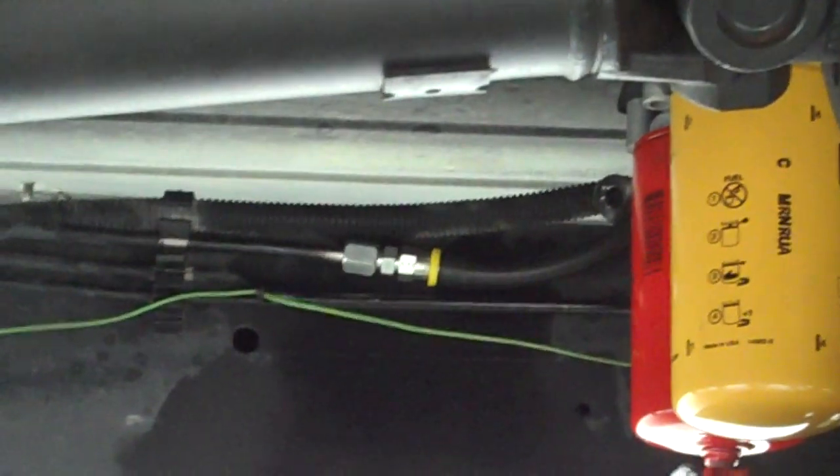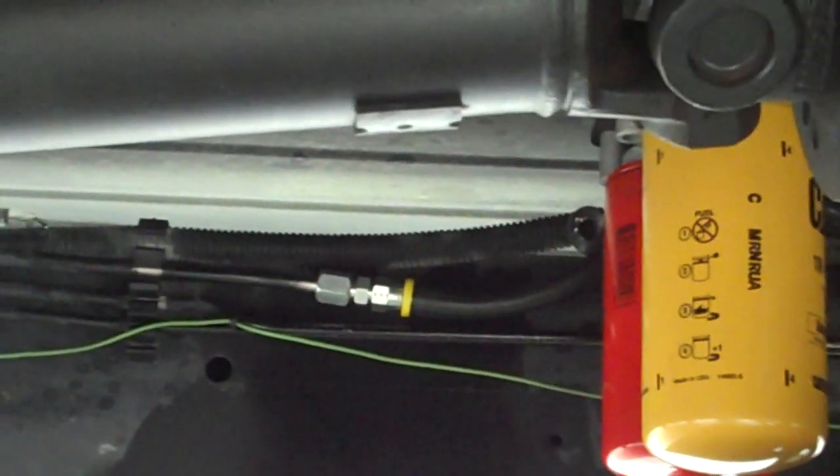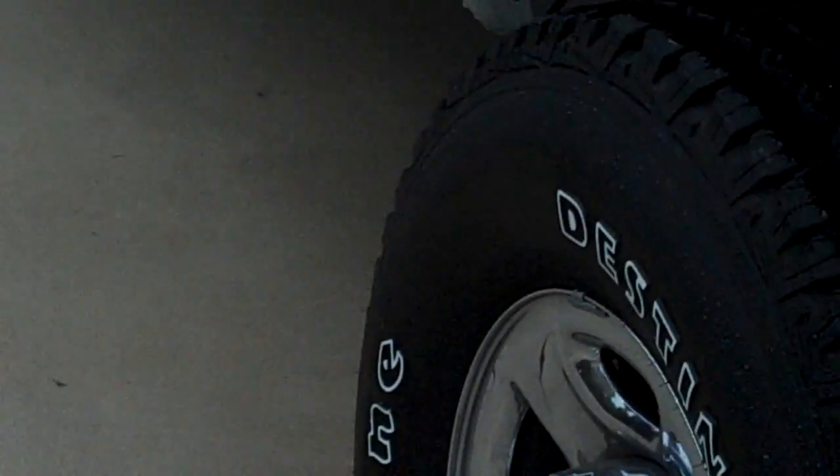We are 99.9% done — there's the completed system installed. Had a little fuel drip on a fitting, tightened it up a couple of quarter-turns and it stopped. Both filters primed, truck started right up, looks good. I'm happy with how it sits up in the frame. My skid plate covers it so I'm really happy with where it ends up. Those guys really did a nice job on the design — real simple. The only issue was that it poured rain while I was working under the truck and I got soaked.